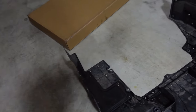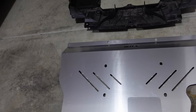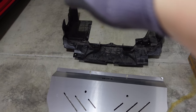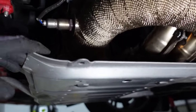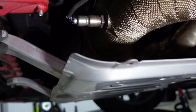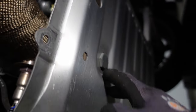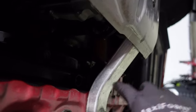Just a little side-by-side comparison. The first thing I'd like to point out is that you will be losing the side pieces that go all the way up. For the WRX at least, you don't get the side pieces anymore that go up and into the wheel well, but that's not a big deal — I'd rather sacrifice that for a little extra protection in the front. The next thing we want to do is remove this piece right here that is hooked onto these two arms. This entire tray has to come off and we need to take off four bolts — one, two for the first arm, and three, four for the second arm.